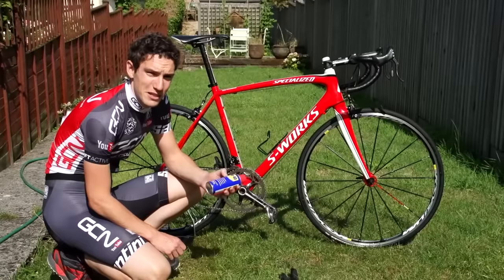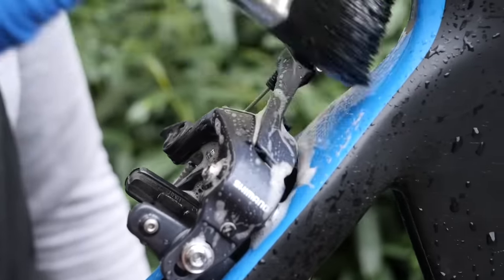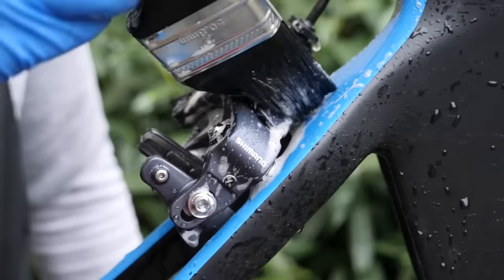Next up is people washing their bikes badly and damaging them. This really, really annoys me. It really does my head in, because there's so much bad information out there about how to wash your bike. You don't wash your car in the way in which a lot of people wash their bike, so why would you wash your bike like that? So I'm talking about doing a contact wash with an abrasive brush. This is so annoying. Abrasive, coarse brushes are going to scratch and mar the paint on your bike as they would on a car. They're going to cause little micro scratches in the lacquer, which is going to cause it to dull and just look crap. And it's going to age your bike faster. So if you go and sell it in the future, it's not going to be worth as much, it's not going to look as nice.